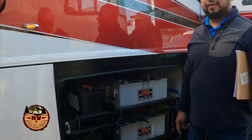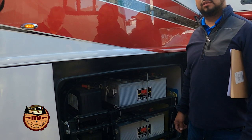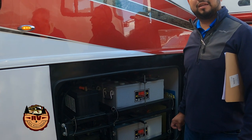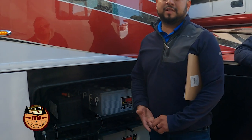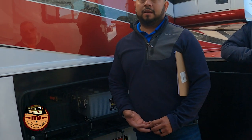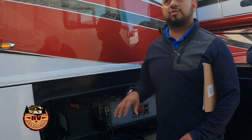Do you have to know what the top off volt settings should be for AGM? It depends what your model coach is. It's a 2020 IH-37. 13.6 or 13.8 kind of sounds right to me. Well, that's what somebody told me, but mine says 12.8. That's not right. When you're done charging, it should be above 13. Yeah, 13.6, I believe, when you get to that final charging stage, should be around 13.6 to 13.8. And what should it start with? 12.2. But I thought that 12.8 looked low to me. When I was reading the literature for the battery, it said like 13.4 to 13.6 on the top off. Where are you seeing this? On your Silverleaf panel?